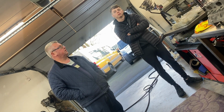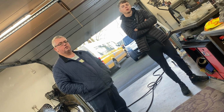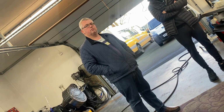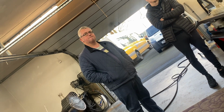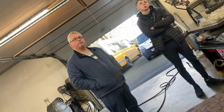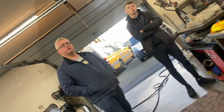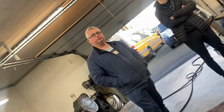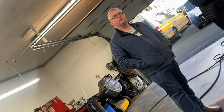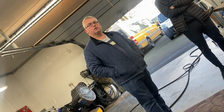That's Chris Turbo. No, from what I can gather, and I spoke to someone about this, when you go to gasket manufacturers like Athena and Cometic, they buy all the old machines from people like Victor Reinz and massive gasket companies. The massive gasket companies buy new machines, so everything gets passed down the line. So the thing that I got told about the gaskets, because we had a discussion with the guy at Cometic at one of the shows, they try and put a raised firing ring in the steel. Cometics, Athenas and all that struggle because it's the old school machinery.